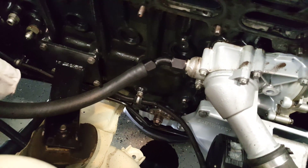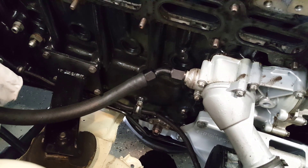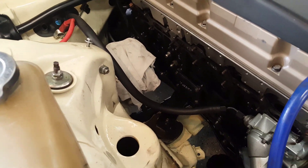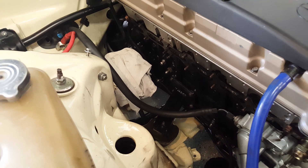There is a small exhaust leak. I have two turbo drains now, so I'm going to have to order a 10AN cap to go on the pan's 10AN fitting. I'm going to clean up the block and the wheel well here before I do any reassembly. Then I'm going to go ahead and install the KKD header.